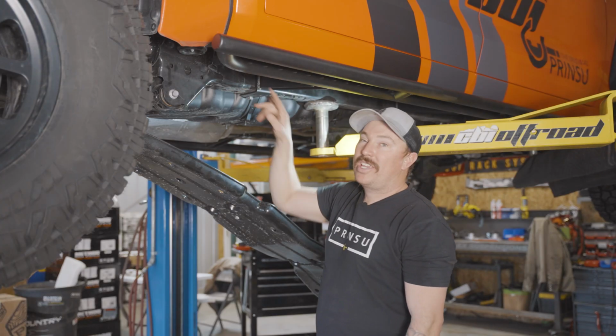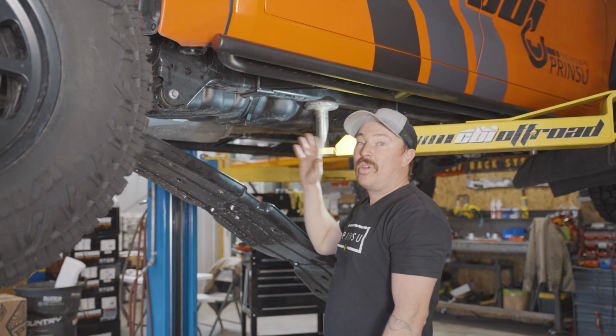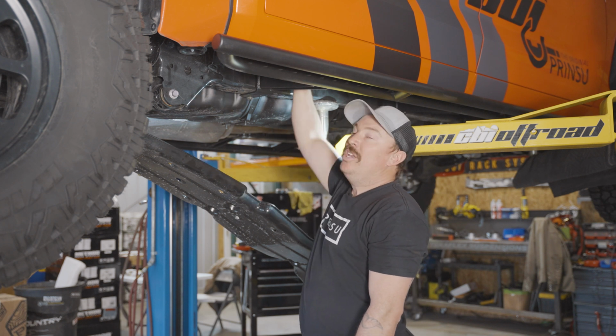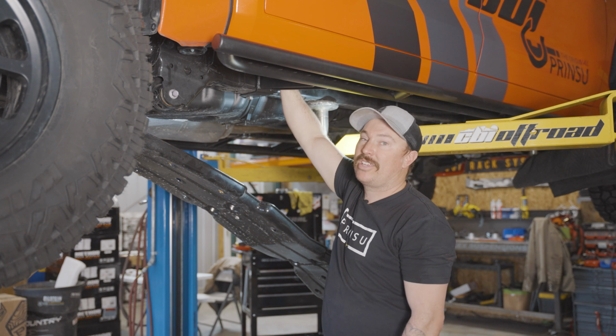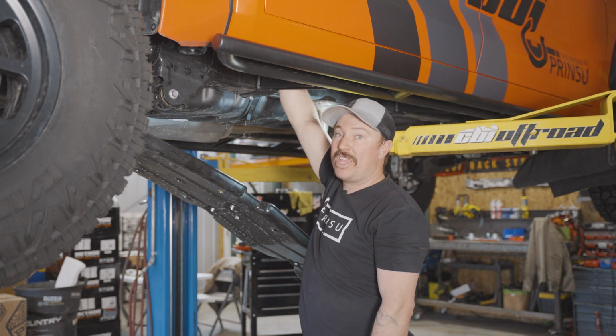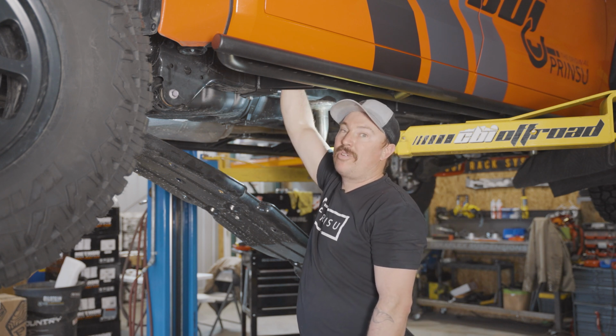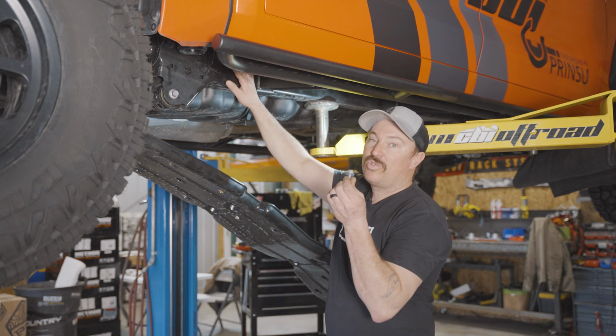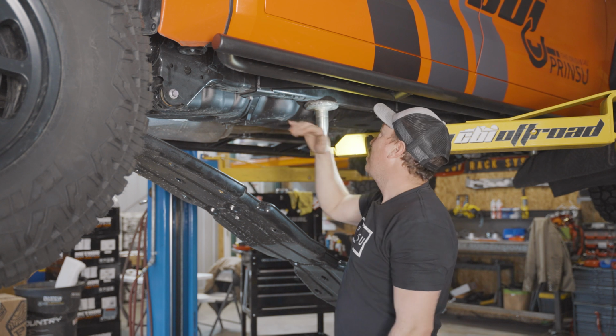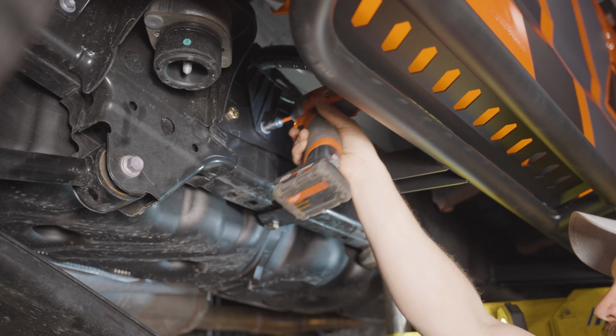All right, so we went ahead and tightened these 2 bolts down. We'll just start making our way backward, getting everything tightened down. Very important, reach up there and just make sure that these lines are not making contact. Everything's gonna be really close and these will remain unclipped, but just make sure that they're not making contact with the bolt going up, and then we'll re-secure with our 12 millimeter bolt this hole here, and like I said, tighten down up there.